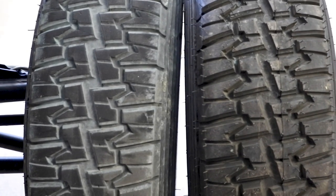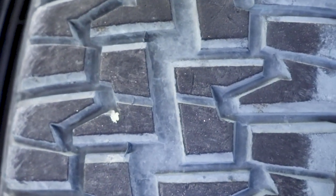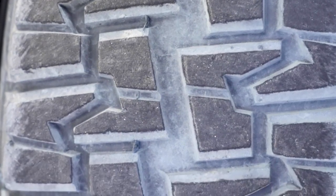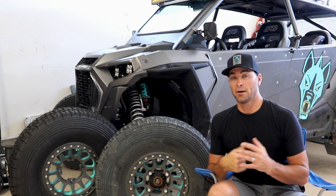Here's a close-up shot of what they look like compared to my brand new spare tire, which I haven't had to use yet. No issues with any flats. I've been riding the tires anywhere between 7 psi out in the dunes to 12, to as much as 16 psi.